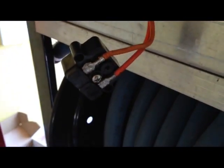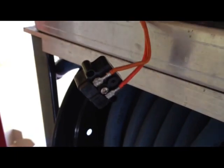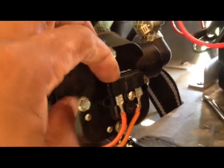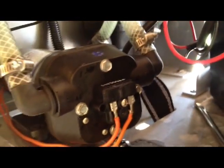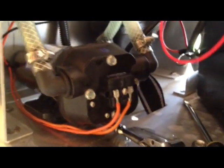It's switched over now. I'm going to hook it back up and run the pump and see what happens — we're supposed to get power there. You always want to put in these screws first before you screw on the cap, because these screws won't be able to fit in once the cap is on. So put these screws in first and get them tightened up. Before we put on the cap, we want to test and make sure everything is alright. And we have water spraying out the other end now as well — success.